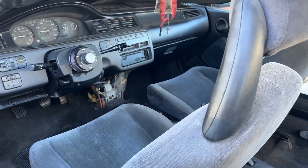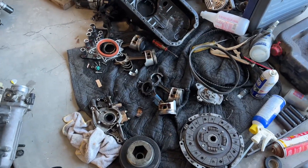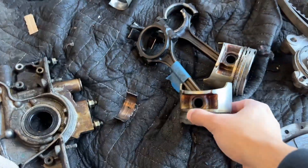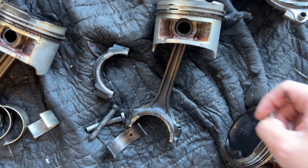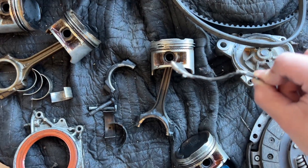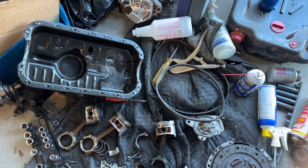The car is just sitting here pretty much taken apart. Hopefully we can get it running in a few months — that's the plan. All the engine parts are sitting here. We took it apart around December. What happened is we spun a bearing, and I'm pretty sure it's because we started the engine out of oil. These are some of the pistons — this one's the worst one, as you can see it's really dark. Some of the bearings were like cooked on.